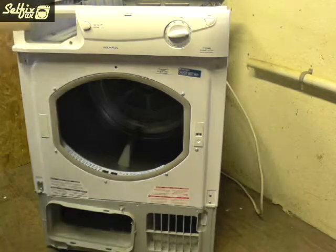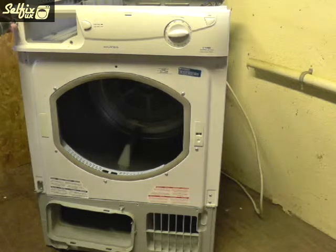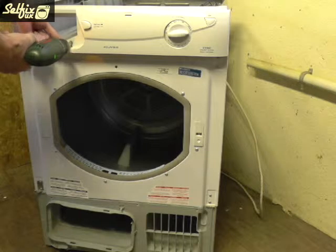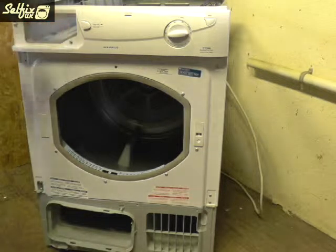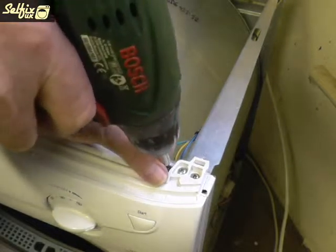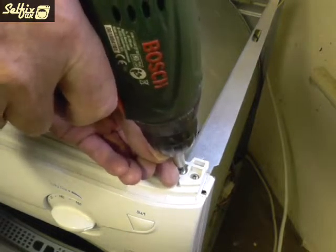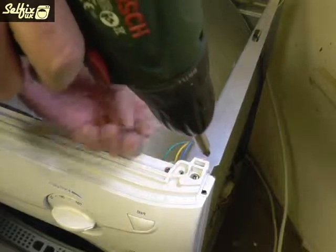Remove the water reservoir and then the two screws on the fascia panel. On top of the fascia panel on the right hand side there are three more screws which all have to come out, although only two are screwed into the support bar on the side. The centre one goes through it and will prevent the front panel from coming off if not removed.